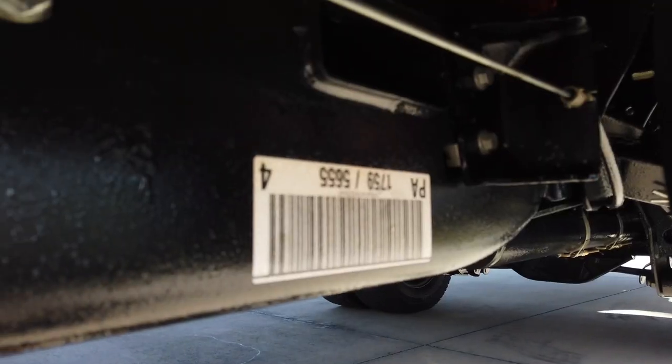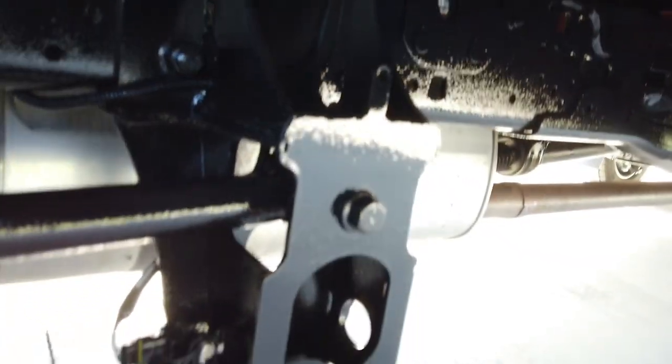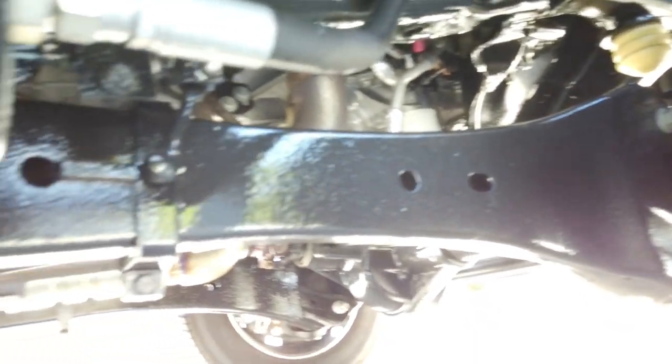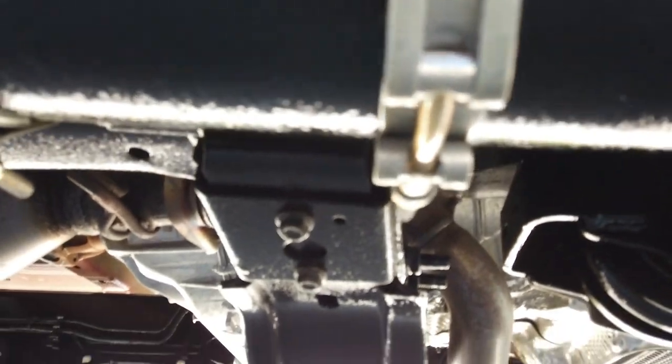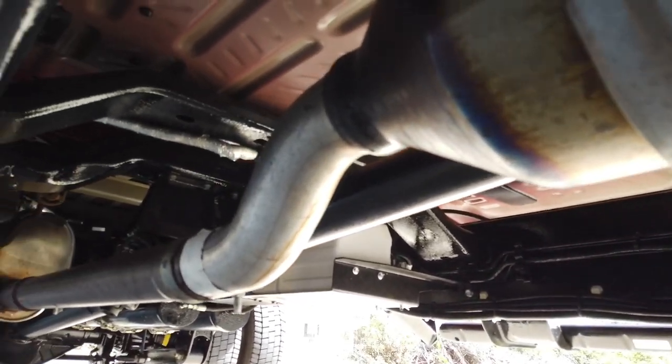Although I can't speak to the long-term durability of Surface Shield, I can accurately talk about the application process. Using the Surface Shield right out of the bucket at room temperature in the wool wax spray gun at 80 PSI, it allowed me to spray beautifully. It gave a nice even undercoating as long as you keep moving, and I witnessed no drips — even if I sprayed it a little heavy, it spread out and didn't drip on the ground, which was amazing. Other undercoatings I've tried in the past definitely did drip. I've checked underneath the vehicle for a day now and there are no drips — spraying this on worked fantastic. Of course it's a new truck so I wasn't covering any rust, but this should keep it protected for two years as they say, and then I can readdress if I need to spray again.